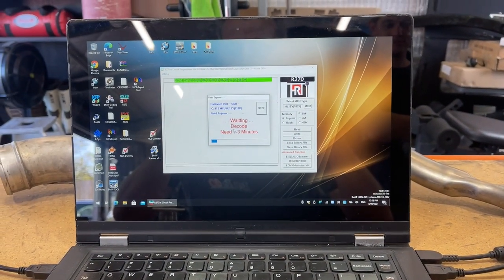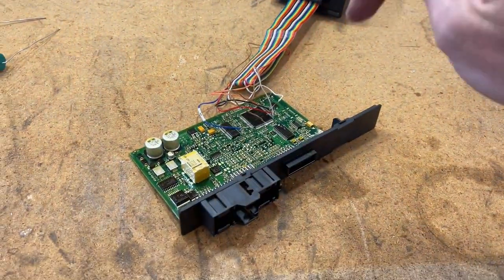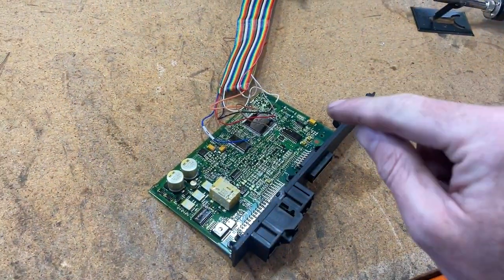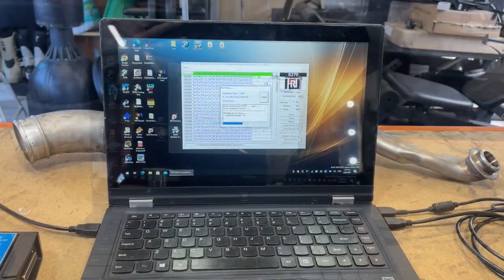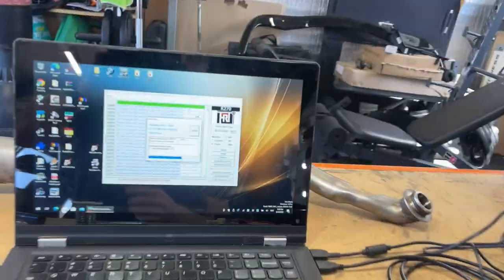I'll probably have to heat the chip up again — we'll see if it works without doing it. If not I'll have to grab the heat gun. This is the most important part of the job: we're reading the security data from this car's CAS, and if all goes well we can put this data onto another CAS and we're good to go. I'm also going to read the flash part — not the EEPROM — that stores all the car's vehicle data, like that it's a coupe and all the functions and features it has. It's basically the software on the CAS. If this goes wrong I can flash it to one of my other CAS modules. The EEPROM is the security data — with both the flash and the EEPROM we can get the car operating again.